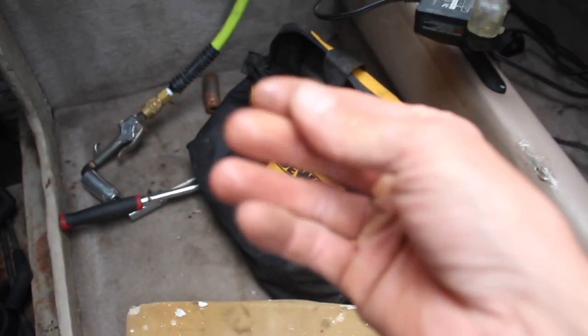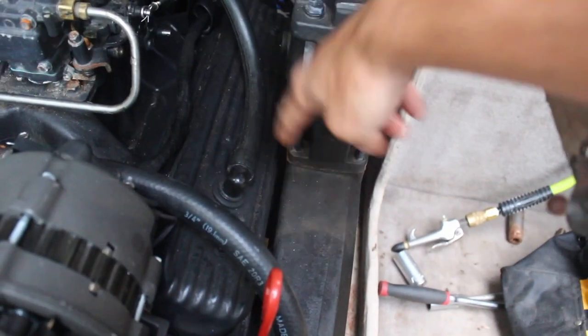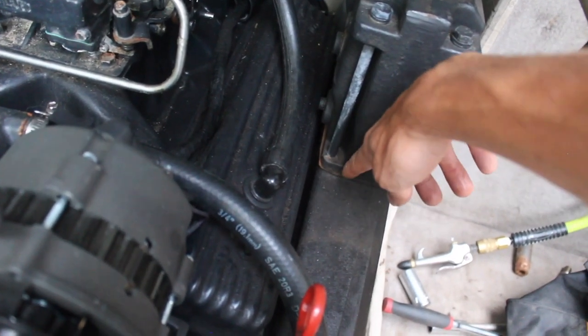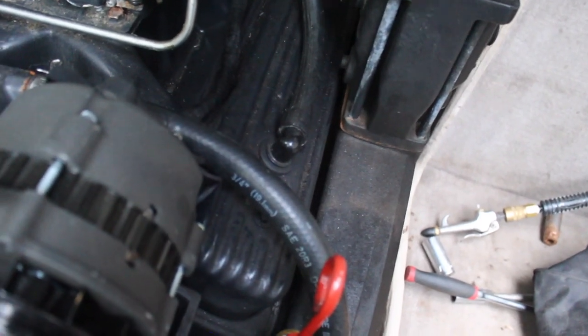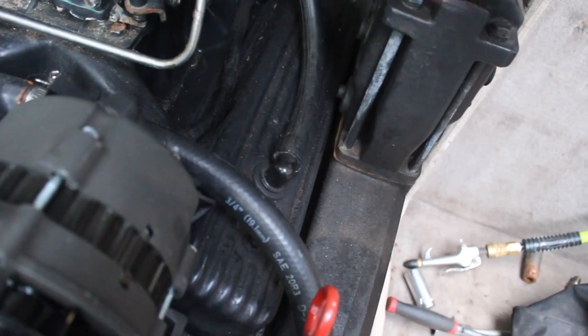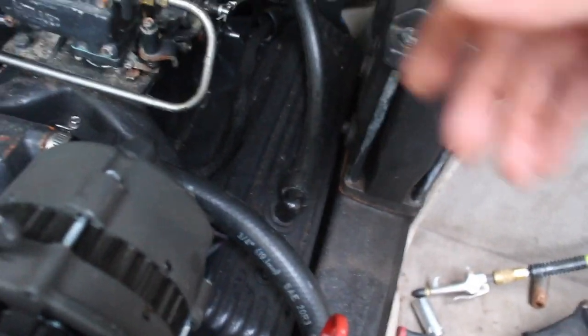Okay. All right, so you should hear bubbling. I don't know if that picked up on the camera, and I actually just got a bunch of water on my hands. So essentially, it's leaking down. There's a potential it's the gasket here, which just has the exhaust split, but that would mean the exhaust valve on number 5 would have to be open, and then I wouldn't get a full compression blow like that anyway. So essentially, it's the head gasket.